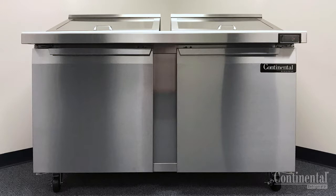If the cabinet is not level, the doors will not be properly aligned and may not allow for a good gasket seal. It will also cause an excessive amount of ice or condensation to accumulate on the inside of the case. This should be confirmed prior to calling for warranty service.